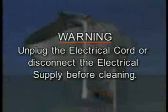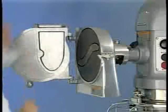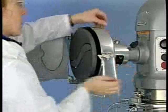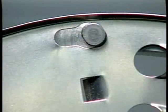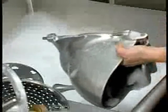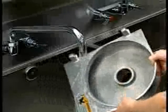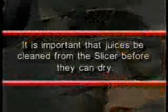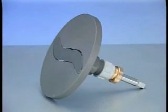Warning: unplug the electrical cord or disconnect the electrical power supply before cleaning. To clean the attachment, release the latch and open the slicer front. Lift the plunger and withdraw the rotating unit. The shredder and grater plates are easily removed from the plate hub by rotating the plate counterclockwise to release the key slot from the shouldered studs. All parts may be immersed in warm, soapy water for cleaning. Rinse in hot, clear water and dry immediately. It is important that juices be cleaned from the slicer before they can dry. When using the adjustable slicer unit, make sure it is cleaned frequently to assure easy thickness adjustment.